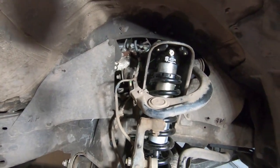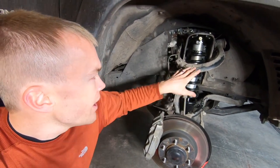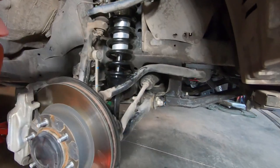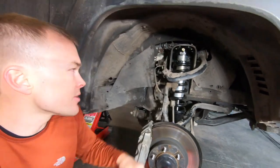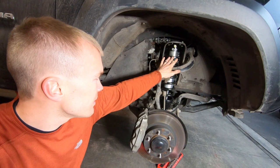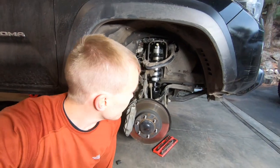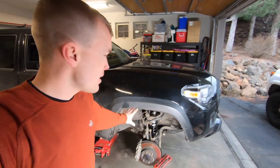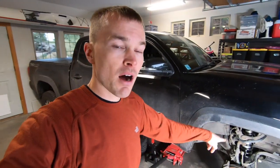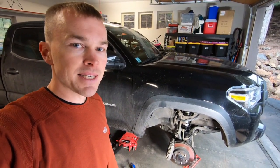Here's a quick look at the completed install — it looks pretty nice and I feel good about the additional clearance we get with the sway bar relocation. On this installation it's not required, but they do recommend replacing the upper control arm. It's a bit tight on clearance now and will get even tighter when we lift the vehicle. Upper control arms are expensive so I'm still debating on that. Next step is to do the lift at the rear of the vehicle, so stay posted for that upload. If you have any comments or questions let me know in the comments below, and for more third generation Tacoma videos be sure to subscribe. Thanks for watching.